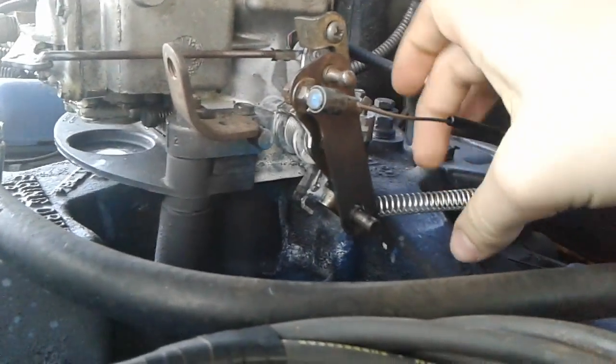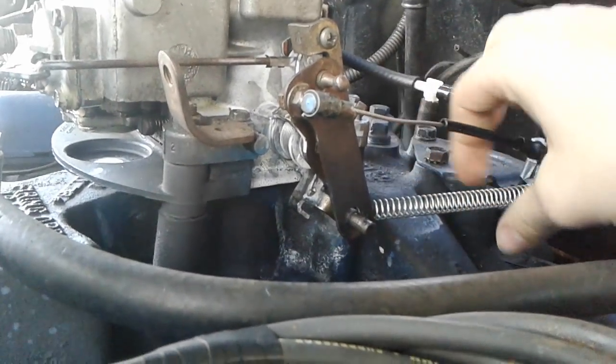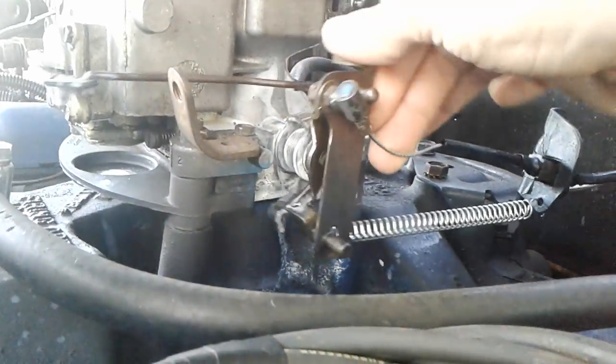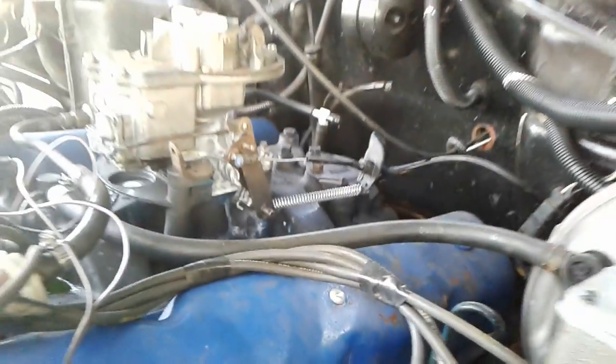Okay, so here's what I did — I put this spring on here. I took it off because I thought it was going to be too stiff, but I just had it positioned wrong, so I repositioned it. I got rid of my old saggy original one and replaced it with this new one, and it works really good. It's got good response and it bottoms out nice and smoothly. All I needed was a new spring, and now the truck gas pedal is where it needed to be. You push it and it comes back, and nothing revs up anymore.